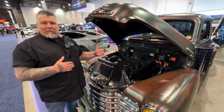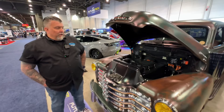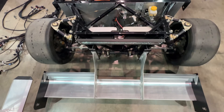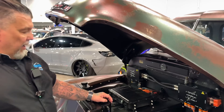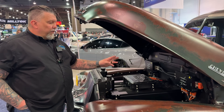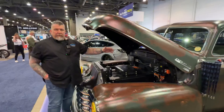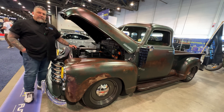I tell everybody I'm more like a hammer, so you take a hammer to the government — that's basically what you get. We got everything passed through; took about 11 months. At the end we're able to manufacture a brand new electric replica vehicle. The setup is a three-pack system from the Atom Drive system and Ampere EV — three battery packs, 42 kilowatt-hours, providing 140-mile range. It's attached to the IM225 motor from Cascadia Motion running the drive shaft, rated at 300 horsepower and 350 foot-pounds of torque. The Ampere EV system has been a godsend — their service after the build has been impeccable, and they're our OE supplier for our manufactured vehicles.